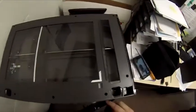So we're going to put that in. I'm going to snap the one side with my hand, clip it there, and then we jump. You see me reach around the other side. Push. We're just pushing it straight up. It's got a taper. It'll go in. It snaps, and it doesn't want to come back out. Now I'm putting the back on. The back is tricky because there's hooks on the right, and there's some hooks on the bottom. So you kind of got to get it in on an angle. And I usually just give it a couple quick, light taps, just enough to seat because they're plastic. They're like plastic snaps. They seated nicely.